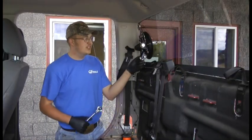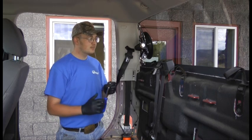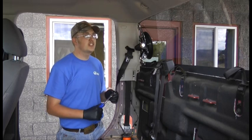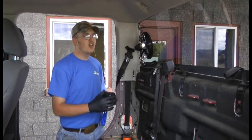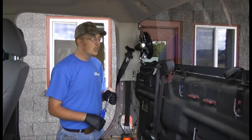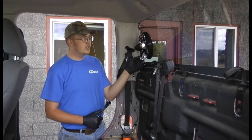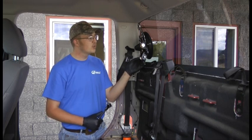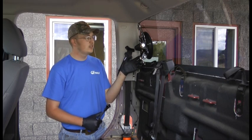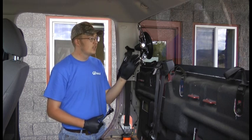So with a shortcut system, you can use a ratchet or a drill. In this particular instance, with it being a confined space, there's not a lot of distance to go. We'll probably just be using the ratchet. We may use the drill on some of the longer sections. With this ratchet assembly on the rear end of your tool, it can only spin one direction, so it doesn't back drive when you stop cutting for a second.